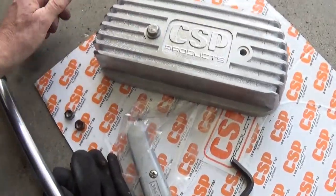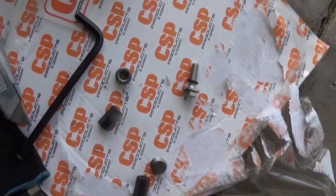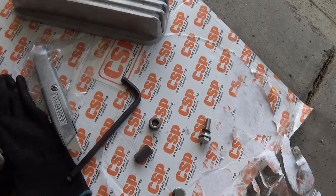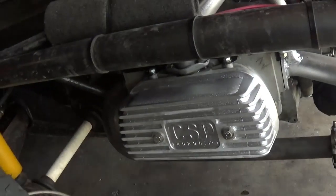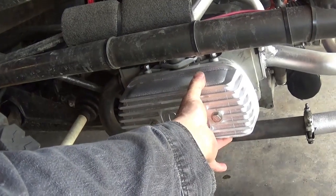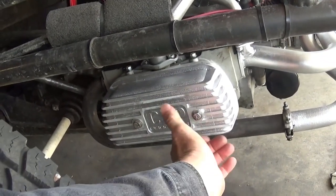But I'm going to get some extra O-rings. I have my O-ring kit, so I'll grab a couple out of there so I know the original size of these O-rings before they get distorted from the heat, because they will. Unless they're made out of something magical, but I didn't overtighten them. I just tighten them down until they get snug, like a quarter or half turn. If it leaks, I'll give it a little bit more.